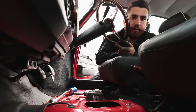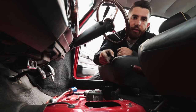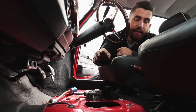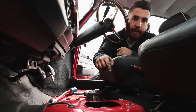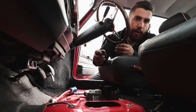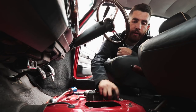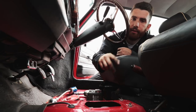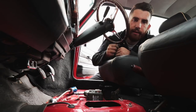Once we have the stock shifter out, the next thing we need to do is knock out the two roll pins that hold the shifter in. The easiest way to do this — because you can't really get a hammer and a punch inside the way it sits — is to lower the entire shifter housing down underneath the car and then punch it out from there. There are just two half-inch nuts that sit on the transmission tunnel; take those off and the whole shifter housing will drop.